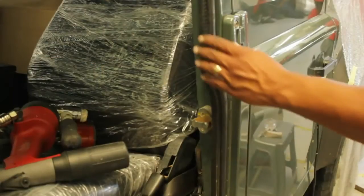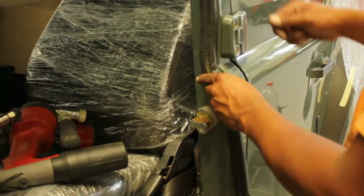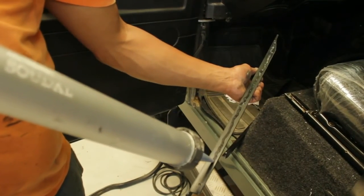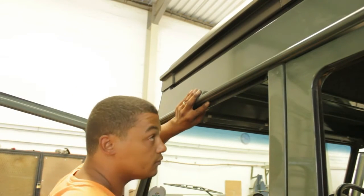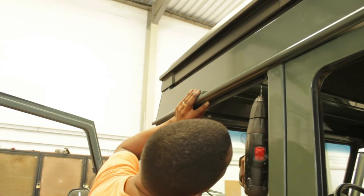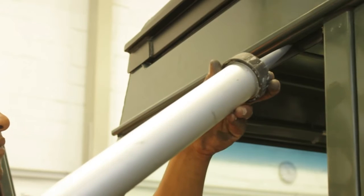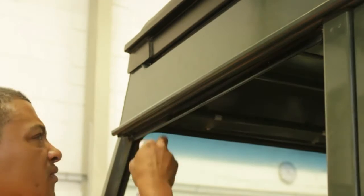While bolting down the roof, you can also set about replacing the door seals and checking all doors are fitting correctly and lining up. You will notice there is no angle or aluminium to mount the door seals at the top of the front two doors. These angles we supply separately, and you will need to drill and rivet these in position, applying glue behind the plates, then align the rubber door seal mount with the existing Land Rover door seal mount area.